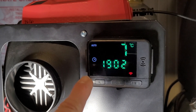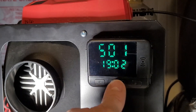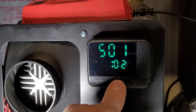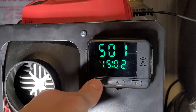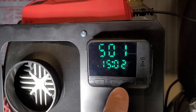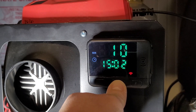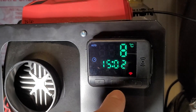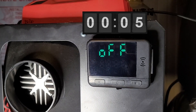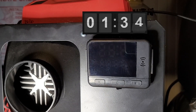To set the clock when the heater is on: long press the left button and S01 will be displayed on the screen. Confirm with a long press of power and the hour starts blinking — adjust the hour, long press power to confirm. Minutes start blinking — adjust minutes, long press power to confirm. That's it. To go back to default display, press power shortly. Now it's in manual mode. For automatic mode, turn it off with a short press of power. It takes a while to cool off after you power it down.